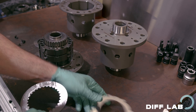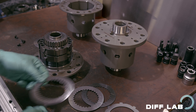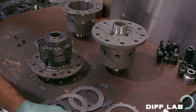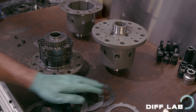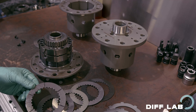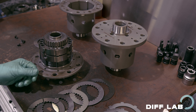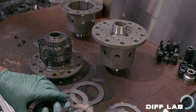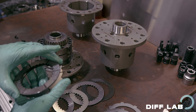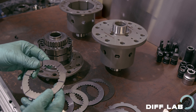The plates are separated into outer and inner — outer is on the right, inner is on the left. Now let's have a look at the finish on these plates. Grooved — six grooves each. You'll notice when they go together, a grooved surface mates with a non-grooved surface, such that all of the slots face the same way.